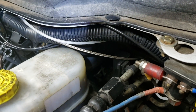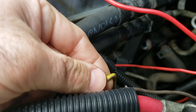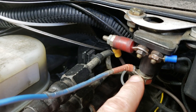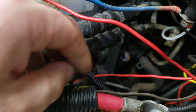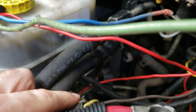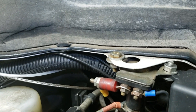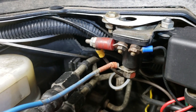The update is: you can see this yellow wire right here that goes down to your starter. What we did is put the diode in-line here — in a little while this wire will get cut and the diode placed in-line — and then we tap off from behind it to trigger the starter energizer. Make sure the diode is flowing the correct direction so it can't back-feed, and put the trigger wire for the solenoid on the front side of the diode. That way if the key turns, it gets energized and goes to the starter, but if your starter gets stuck it won't back-feed and keep your truck running or burn up the solenoid.